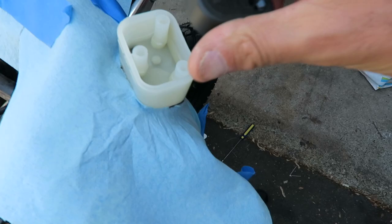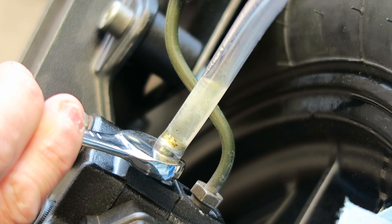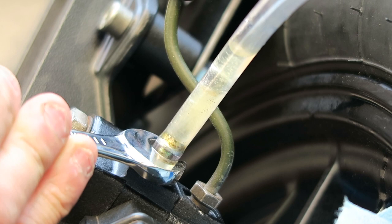Very carefully. Cover it while you're working, so you don't by mistake spill anything. And on with the sequence. Open, press the brake, close, release, open. There, all those air bubbles, that's the bleeding. That's what you want to get out.